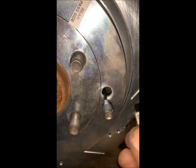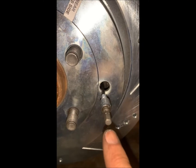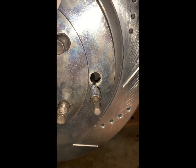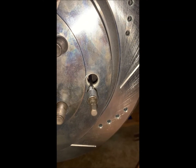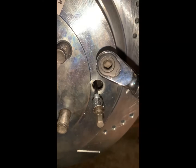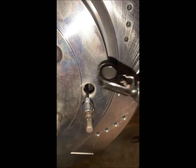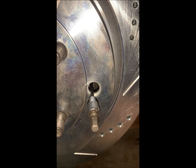And I have this little adapter, and this is probably the key to the whole project. This little adapter goes in my 4mm socket, and on this end it's a 1/4 inch hex, and this 1/4 inch hex will fit in the torque tool that's in the tools list. You can buy that tool at various different torque settings. Just buy the one at 6 Newton meters, and that's about 20 bucks. Otherwise, you can buy a torque wrench with this kind of end on it. These are exquisitely expensive, and it has proven to be a very poor piece of equipment because the gearing in this head is just junk. So I would highly recommend you spend the 20 bucks on the torque tool. Just torque it up to 6 Newton meters then.